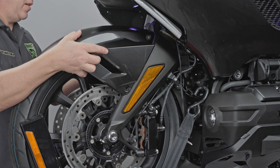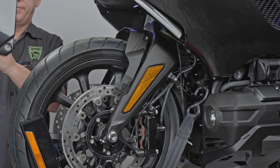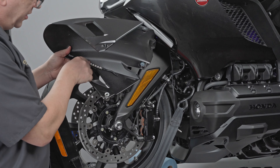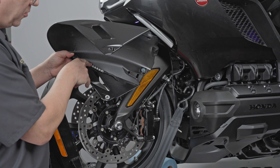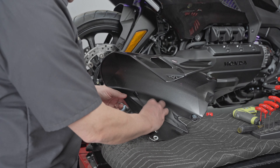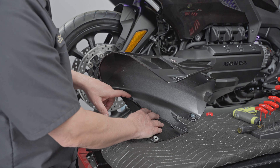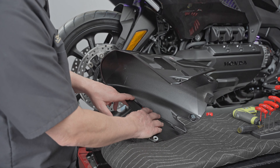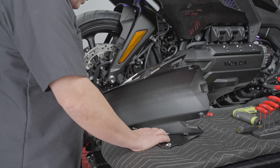With that, I'm going to take the fender right off. Now we can take our LEDs and put them right here on the fender. Tape down the edges to make sure they don't flop around, and we can do both sides right now. Just make sure the male part is pointing to the rear of the fender. Place this right here — you want this end that's facing forward to be in this crease, so we stick that down so it's not flopping around and doesn't hit the wheel. Do that on both sides.